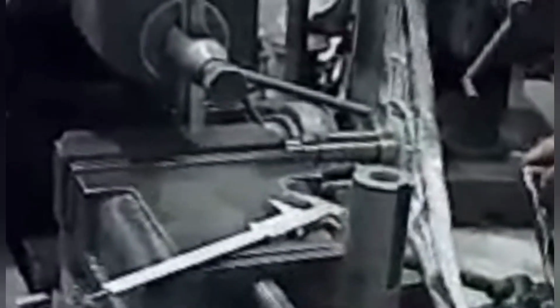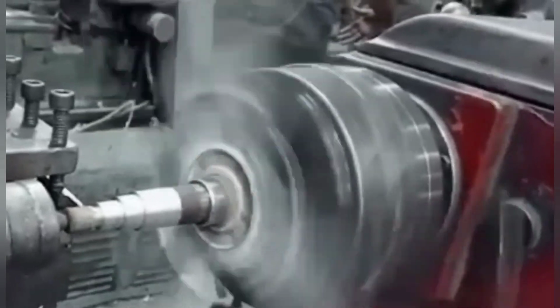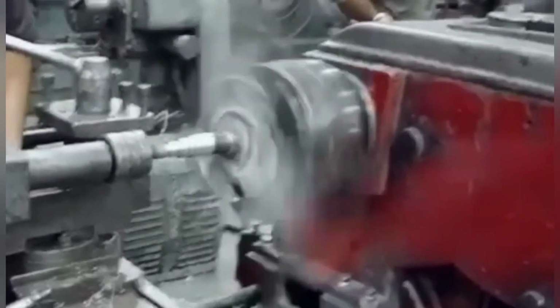Now the lathe machine work is already finished. Both bearing areas and the seal area, everything is done. The shaft is already cut by the lathe machine. Now we have to fix only the pulley, the V-belt pulley fixing area, like this. We have to cut that. After finishing this, I can fix it to the washing machine. Now everything is perfect. Finally we have to make the pulley tightening nut. That is a 17 number nut. We have to make the hole with thread.